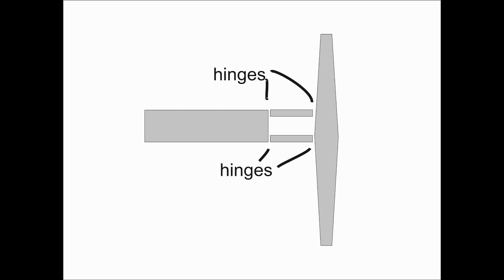So we have a sort of suspension, but because it only has one horizontal hinge, the wheel would tilt over as that hinge plate goes up and down. Modern cars get around this by having the equivalent of two hinged plates, one above the other, forming a parallelogram — which means the wheel stays upright. That also means you need four hinges instead of one.